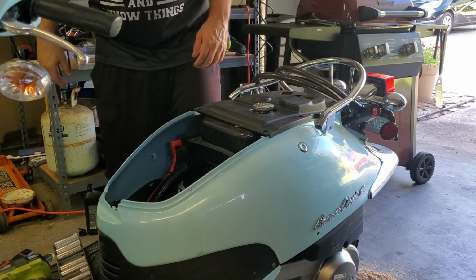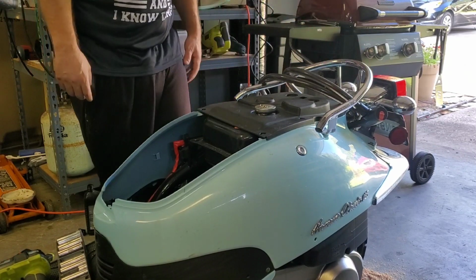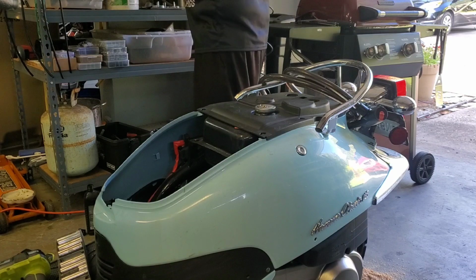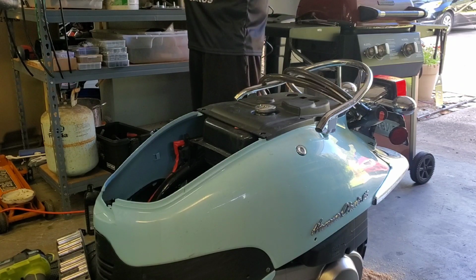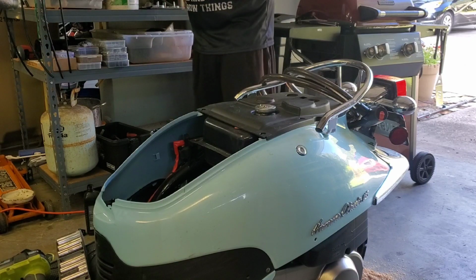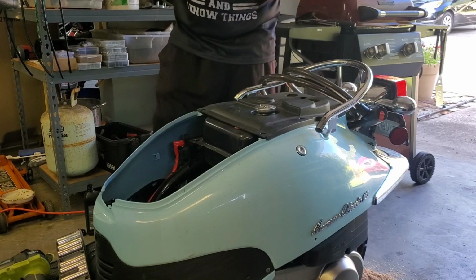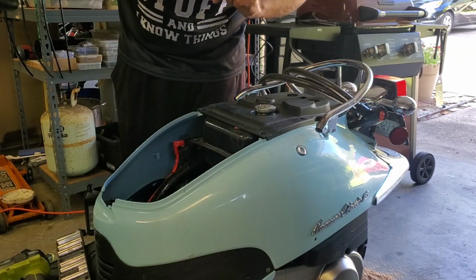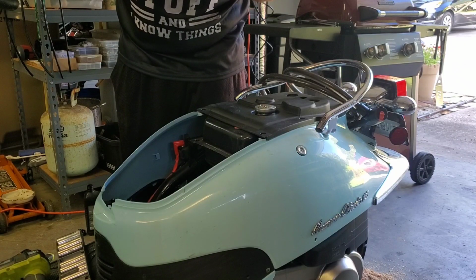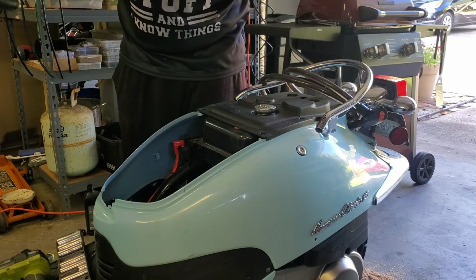You know, it's unfortunate. I'm going to go ahead and clean that spark plug off on the wire brush here. Put my compression tester away. I'm going to grab a brand new wire brush and clean this plug off and see if that makes any difference, but I doubt it. I mean, it's smoking a lot. It's not even cool how much it's smoking. We'll get all the crap off here. It's getting plenty of fuel, so I know that's not the issue. This is all coming back to just, it's just burning oil, man. It is definitely not a happy bike right now.